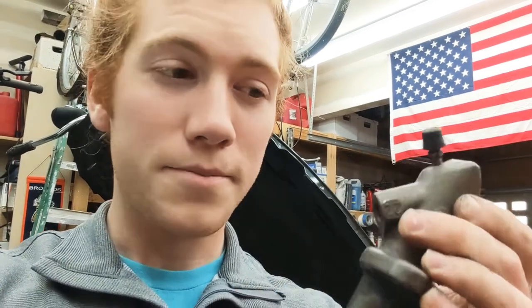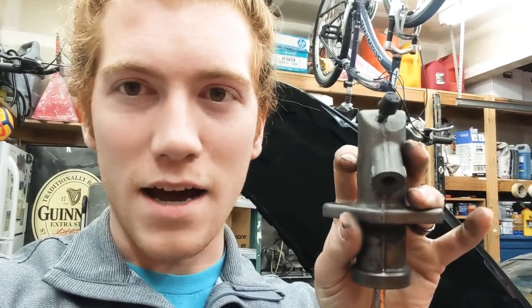What I actually found worked the best for me was I pulled the slave cylinder out of the car, tilted it upright so that the piston is facing down, and then you just open up the bleeder screw. Basically what this is going to do is allow brake fluid to fill up all the way to get to the bleeder valve and let a couple air bubbles out.